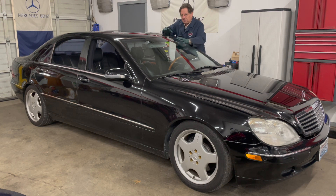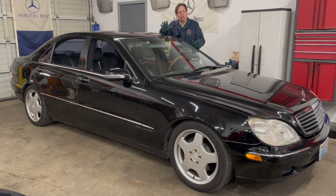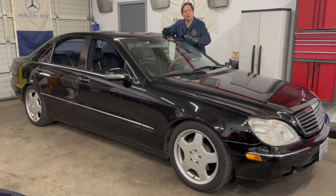The test is: you have a windshield with some scratches in it. You take your fingernails — if you have to get the glove off — and run your fingernails across 90 degrees to those scratches. If your fingernail catches in the groove, you won't be able to polish it out. You may be able to make it look better; it won't be quite so obvious, but it's only those very fine scratches.